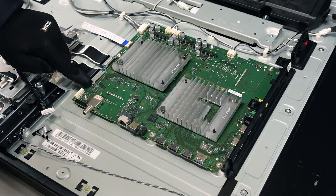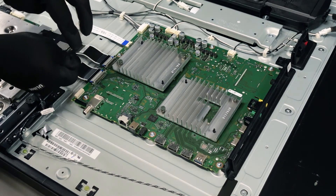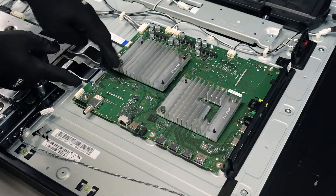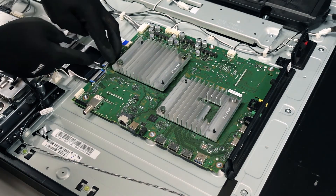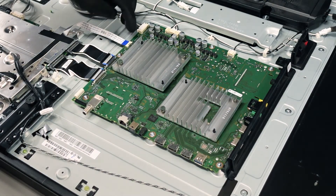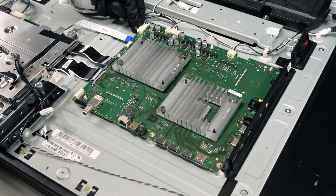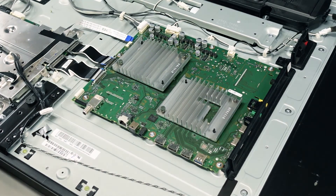Now we've got these ribbon cables. You're going to see two black plastic nubs on the top — press straight down on those and shimmy this cable out from underneath. To show you again: press straight down on the two black nubs, pinch the cable, and shimmy it towards you. Press down and it pulls right out. The exact same thing with the next one: press down on the two nubs, get your finger underneath the ribbon, and it slides right out. This one here has a little metal bracket on top — press down on it and pull the cable out. There we go. This next one is just a regular clip on top: pinch it with your thumbnail and pull it out. Same with the next one — pinch it, pull it straight out. One more — pinch it, pull it out.